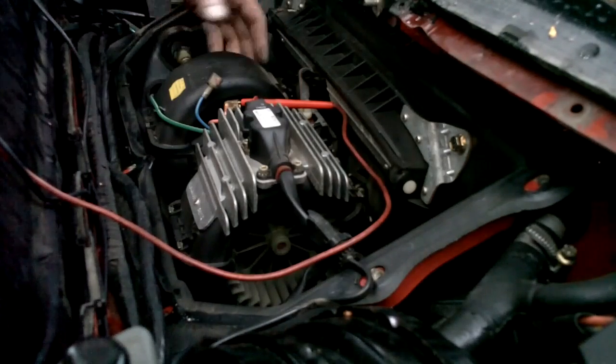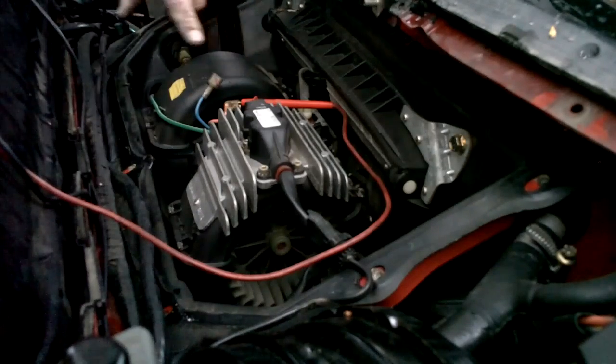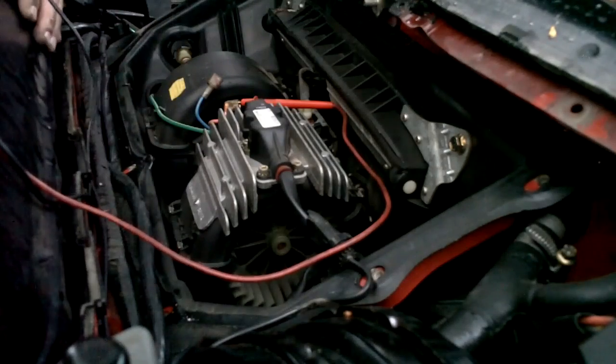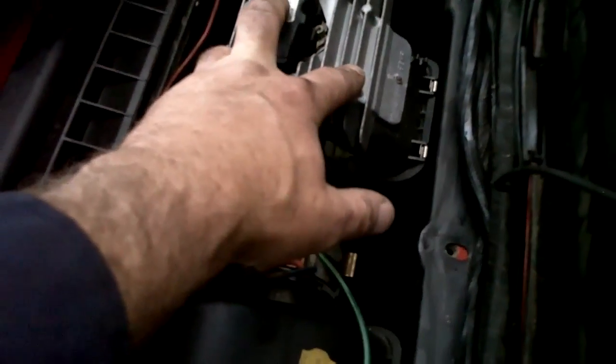Anyway, I've shown you how to take the motor out. Like I said, clips here, and then there's the one major clip. How do you get that one out? Let me grab the camera. Sorry for the fingers. So you've got the clips on top of the covers, and then there's a big clip in the middle around the fan. See the big brass clip that pops up, and you can lift the whole assembly out. You lift the two tops. The top of the squirrel cage is off. This one comes off with the blower regulator, and then you pop the center one off, and that's basically the one that's holding the motor in.